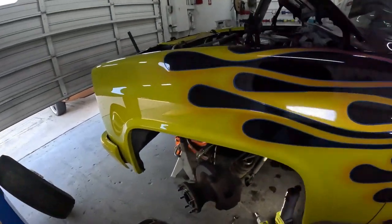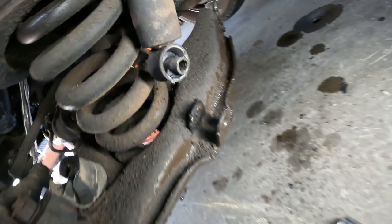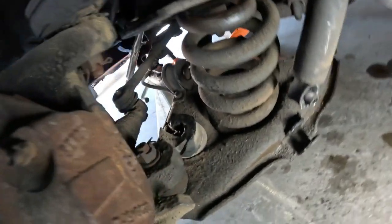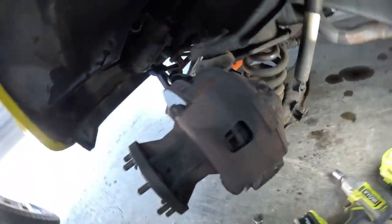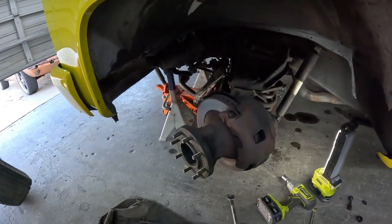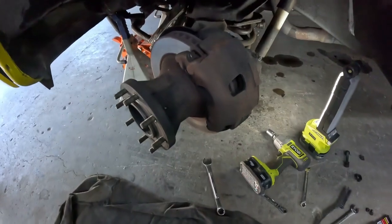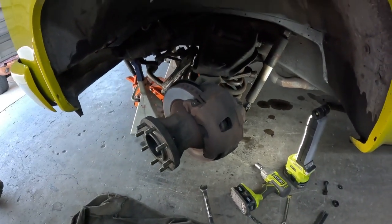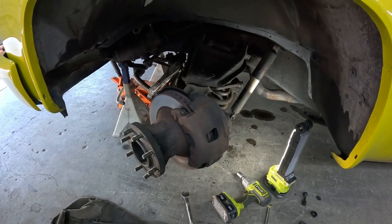Got some of it apart and I got to look at this job a little differently. I unbolted the lower shock, which that bushing is junk also - doesn't matter, it's coming apart. But when I did that it dropped the control arm, and now there's no tension on the coil. I usually use the tension on the coil to bust the upper and lower ball joints loose, because I wanted to take this apart in pieces so it was lighter. But now it's kind of looking like I have to take the control arms off at the frame. The broke side is already off, but I got to do that side, then I'll probably take the upper control arm off at the frame, and I don't have to worry about tension - just a lot of weight of metal. Think smart, work smart, trying not to crush any body parts.